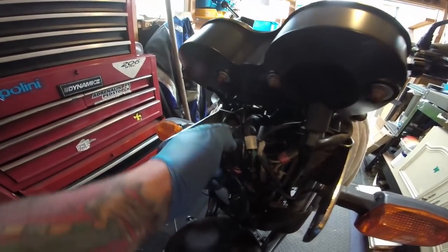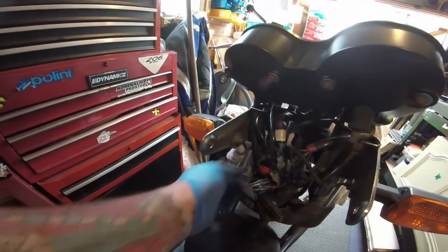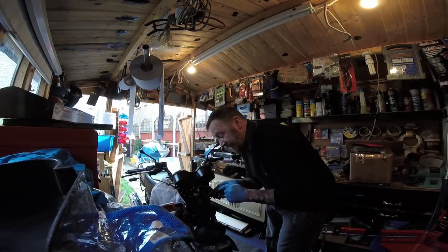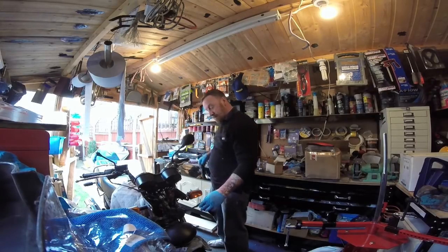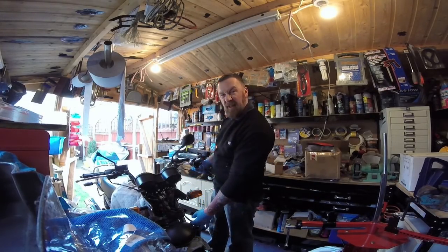Double check your wires before you put it back together again. I've said this so many times, you can so easily pull a little earth out and suddenly you've got no indicators. Disconnect there and simply refit the new one. It really isn't hard. And just missing the base, so moisture and stuff could have got in there. But I'm much happier fitting this nice new one without a crap key.